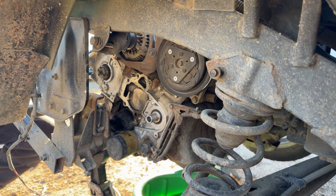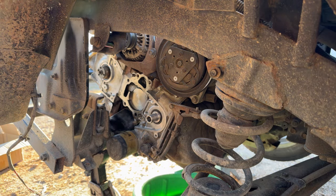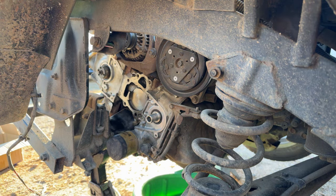I forgot about those stupid side seals. So we got to figure out something about that as well, because they're swollen and deformed. I mean, technically you can leave them out of there, just like with the EJ series engines. You can leave the seals out of the front and rear timing covers, but you have to worry about crap getting inside where your timing belt is.